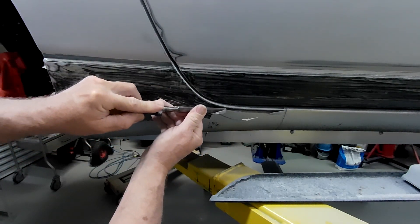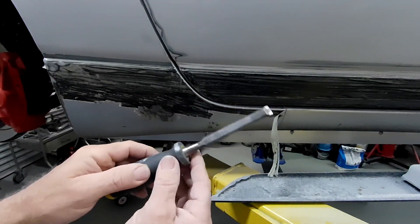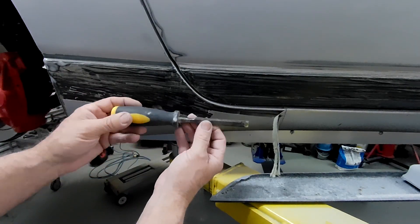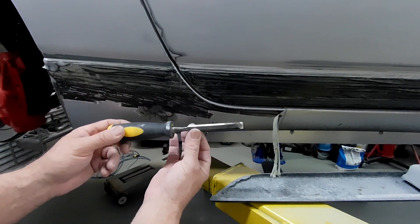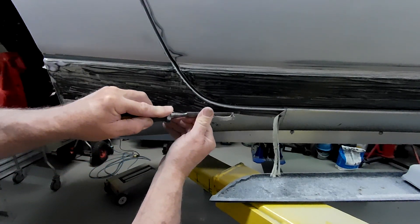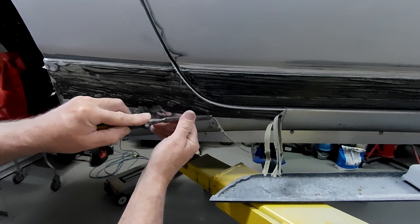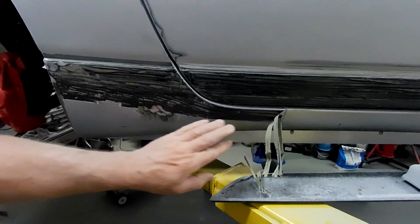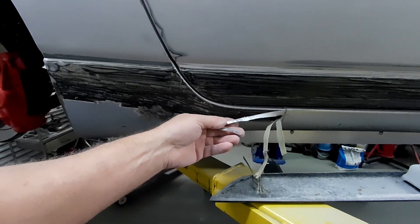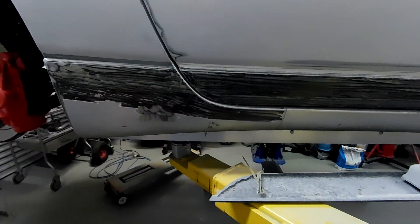Look at that — you just start working along in sections as big as your chisel. Part of the reason I'm using a 10mm chisel rather than a 20 or 25mm is it's just nice and easy to push through that much stone guard, whereas a wider blade would be a lot harder to push through. As you can see it just peels away straight down to the e-coat. There was some stuff sitting on top here, like there could have been a repair under there, but as you can see there's nothing — it's all factory and all mint.